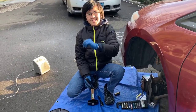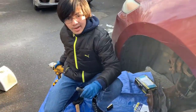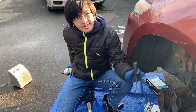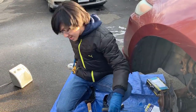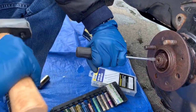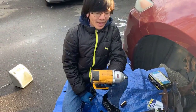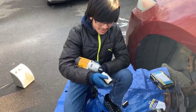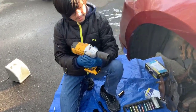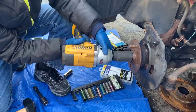All right, so we're back. It's the next day and we're going to start out with taking out the central bolt right here. The only way to do this right now is to use an impact driver. But if you want to take it out manually, you have to do it before you take out the brakes, because you need someone to step on the brakes while you're taking it out. So just keep that in mind. The axle nut — which is what it's called — is around 181 foot pounds, which is why we're using the impact driver. Take a 32 millimeter socket, set it to three, and then bombs away. Hopefully.